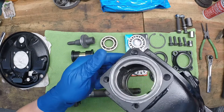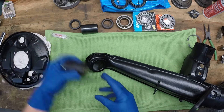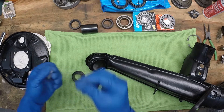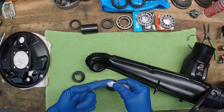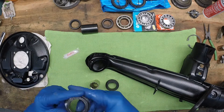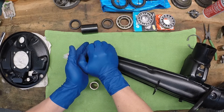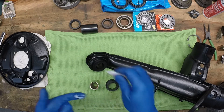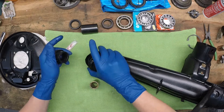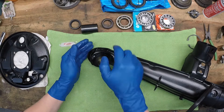Let's get going. We'll start at the front end and put in the two bushings and spacer. Mine came with a little packet of grease — we'll use that to lube up the surfaces that are going to move. This part's pretty self-explanatory: put on some grease and slip those spacers into place. I just pressed mine in by hand. If you need to, pull out the soft face mallet and give them a little tap. Remember this is a pivot point, so make sure you've got plenty of grease so that pivot bolt can move up and down as the suspension travels.